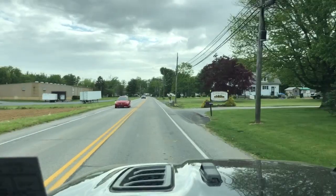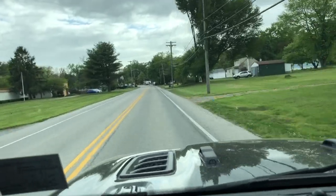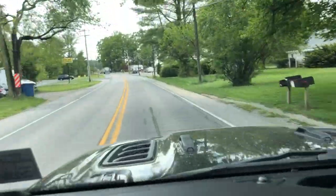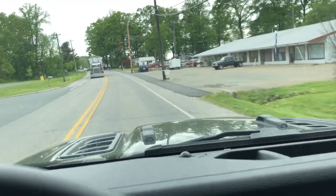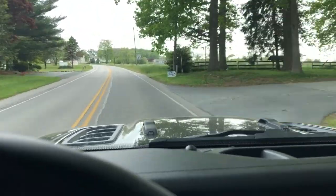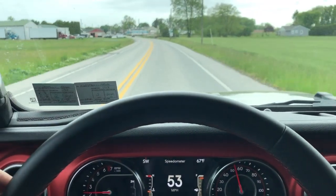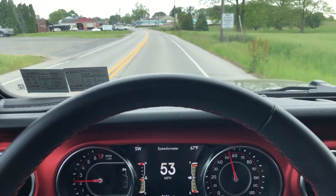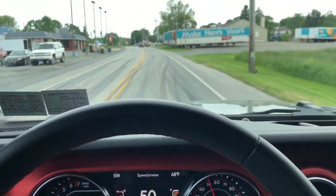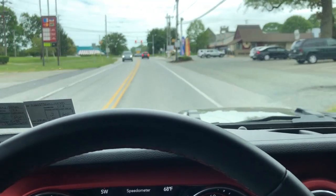Quick drive after the Synergy track bar brace and sector shaft brace install. It's a little more centered, a little better. I hadn't really noticed major issues before, but I definitely notice now I don't need to put in those little steering inputs. I basically did this to brace up for 37-inch tires that are coming, but even with the stock tires it shows some improvement. No little wheel movements — before driving down this road I'd have a bunch of little wheel movements. More of a little nuisance, but it's definitely an improvement. Got a good deal from Bad Attitude Off-Road — overall, impressed.